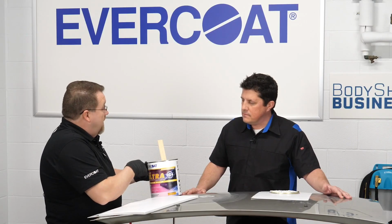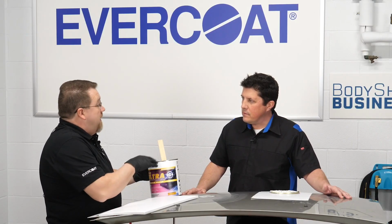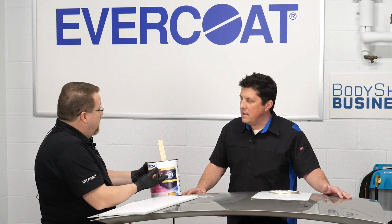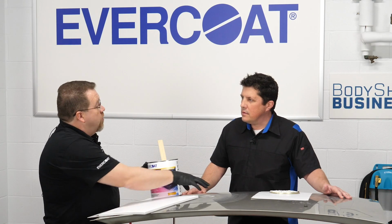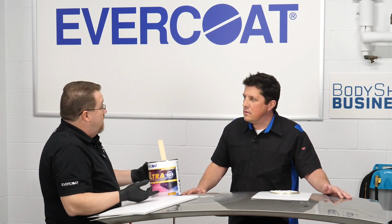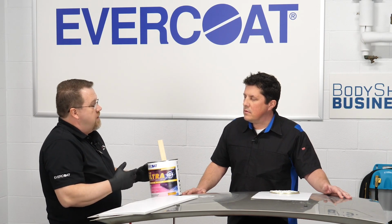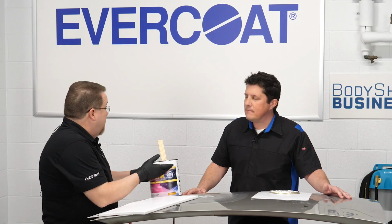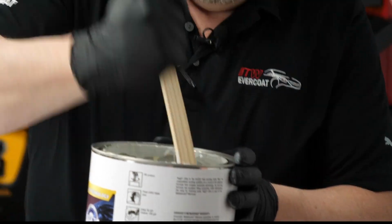And if you notice I had the lid on here, well, we want to make sure that we put the lid back on, sealed up, before we leave at night, because otherwise the product dries out. As it dries out, it's harder to work into the surface. It's harder to get the air pockets to come out, so we're more likely to get pinholes. I usually hear more people talking about getting pinholes as the product starts to get used up, because it's drying out at that stage. So we're going to mix it up real quick.